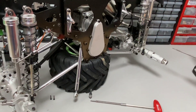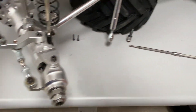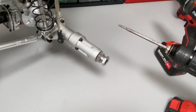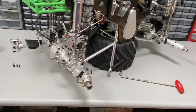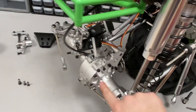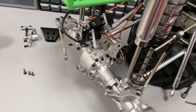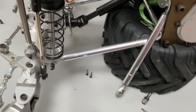Something else to check quickly is to spin the drive shaft by hand and make sure that when it spins, the front axle is also going forward — that just means you know you installed the diff correctly and you don't have to switch it. I just finished snugging up all these bolts; I'm going to go back and fully tighten them again in a crisscross pattern. Also don't forget these two little ones in the back.